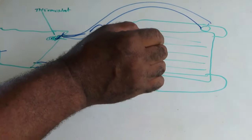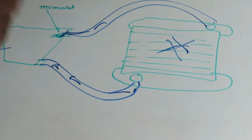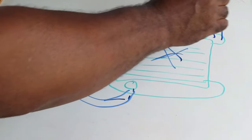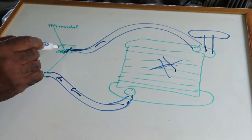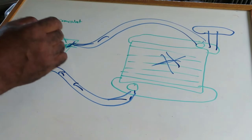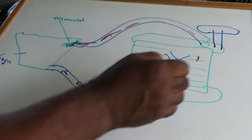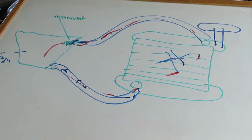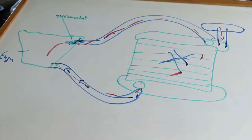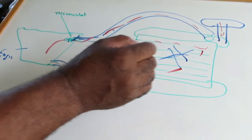Once it stops circulation, your fan is going to cool off the coolant and the engine cools down. Now, if you don't take out your thermostat, once you remove it, the system is going to flow all the time — it's just going to keep on going because the thermostat is not there. If you don't do that and you start pouring Blue Devil in, where's it going to go? If your thermostat is closed, it's only going to go into the radiator and clog it up.